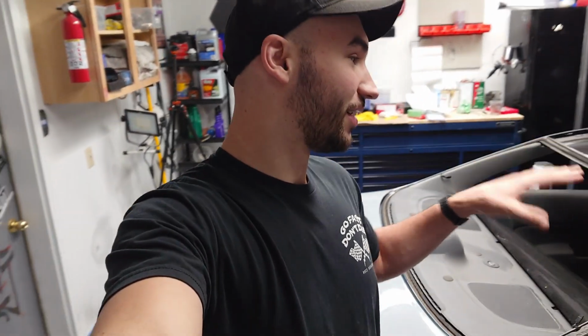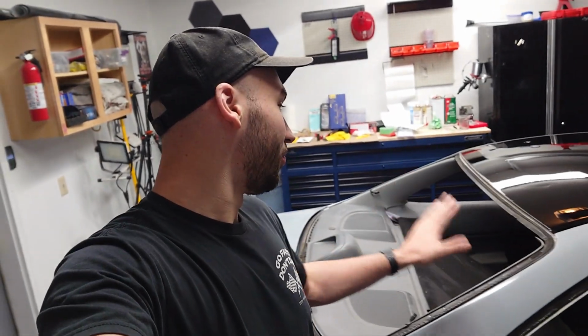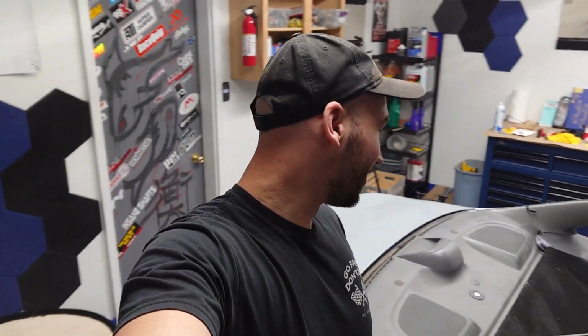So now, if you want to see me install new windows in the car, make sure you subscribe and have your notifications turned on. I got a set of YNS Lexan 35% tinted windows that I'll be installing. On the sides, I'll be sealing them up with new urethane and rivets. And then on the back, I'll just be using urethane. But I'll get those custom painted and everything, make them fit all nice. I'm gonna have new OEM Honda moldings installed on there, and we'll install on the car.